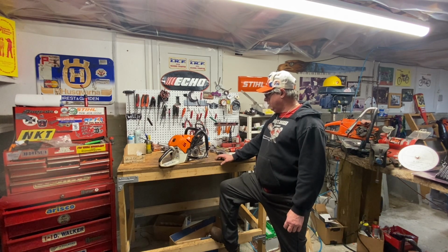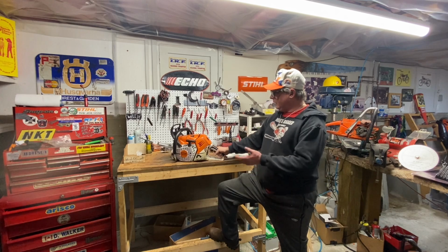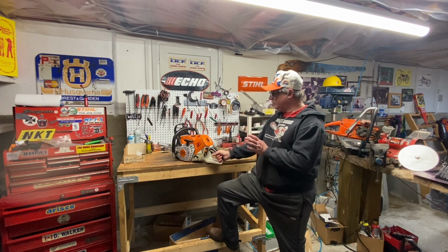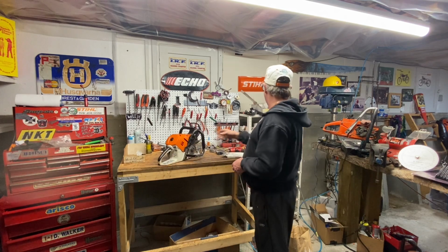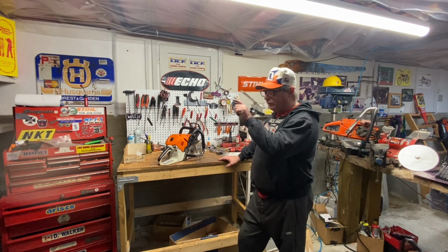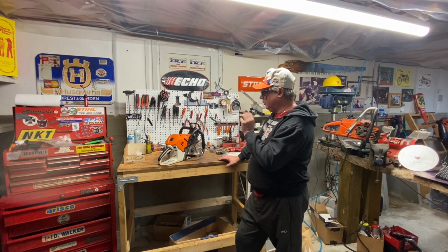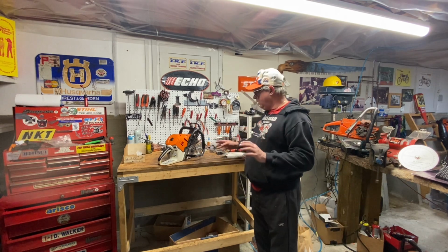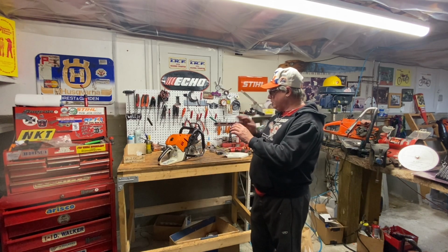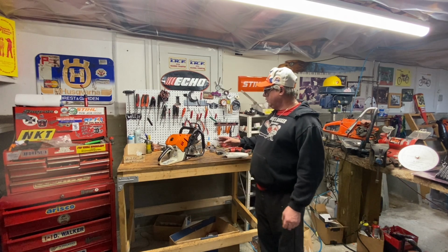funny situation there. This saw was actually built out of two saws. As I took it apart, I noticed it had been worked on, and I wondered why. There were a few blemishes on the piston, the type I've noticed on a lot of other pistons, because I've taken thousands and thousands of chainsaws apart in my lifetime. It had all those little marks, like a bearing cage had gone through and messed the piston up a little bit. Not that bad though, okay? Don't get me wrong. Matt, by the way, you own the saw. It wasn't that bad. I cleaned it up with a bit of Scotch-Brite, but it was fine the way it was. But I wanted to clean it up a bit because I ported it,